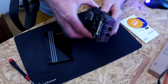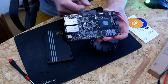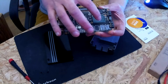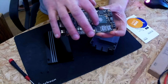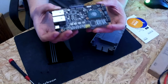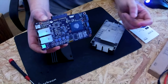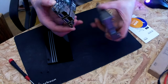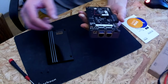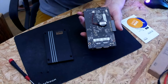This is holding the heatsink together with the PCB, and then you slide it out. Now you can see the Intel processor, and this seems to be memory — it's the version with four gigabytes. The version with eight gigabytes will also have chips on the side. It has thermal conductor so the heat is transferred over to the heat pipe and to the heatsink.